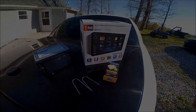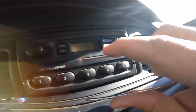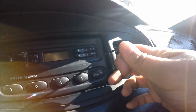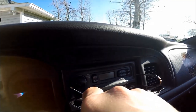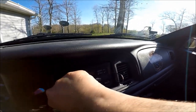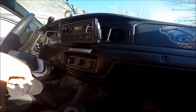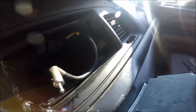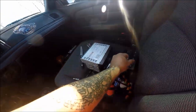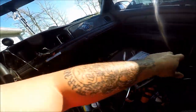Your first step is to grab your radio disconnect pins and insert them into the two holes in your stock radio — they go in about halfway. Wiggle the radio a little bit and it's out. Once your radio is out, the antenna literally just unplugs, and just undo the connector like that. Believe it or not, you've just completed the hardest part. It can be a bit of a pain because of the little pins that lock into the sides, but it's doable.